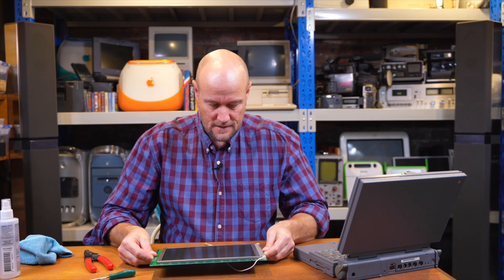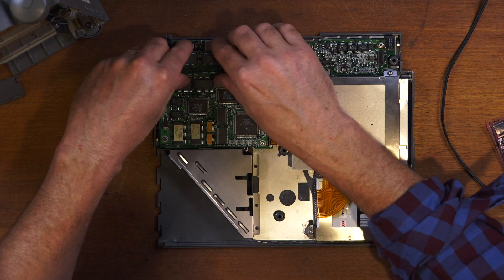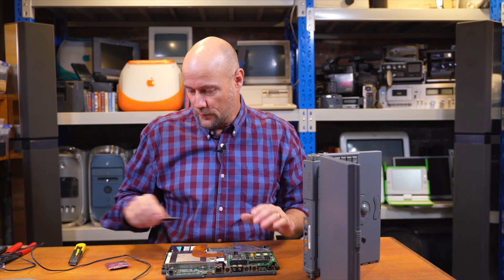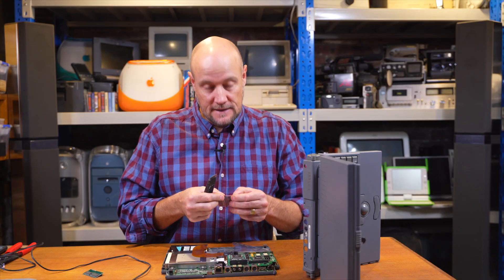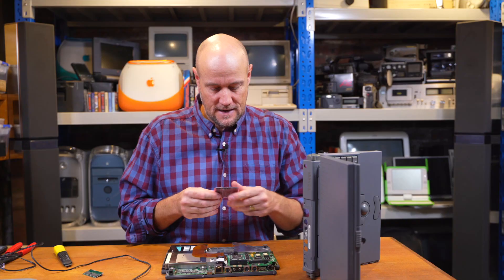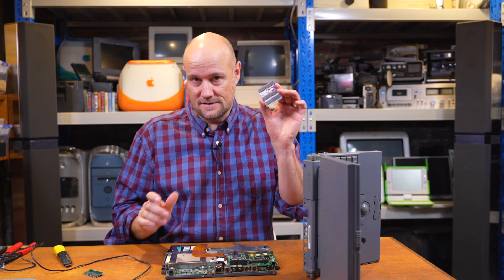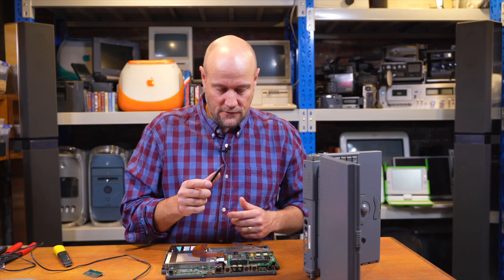Okay, that's them all tightened. Here's our screen. Let's get it back in the machine with the upgrades, fire it up, and see what happens. I've pulled the top of the laptop off to get access to the CPU and memory area. We're going to remove the old chip — this is actually a 2 megabyte chip, so there's 2 megabytes soldered onto the motherboard plus these 6 megabytes, which is going to give us an 8 megabyte machine. Silicon Insider is the guy who makes these — you can find him on Instagram. He makes RAM and VRAM and all sorts of cool things for old Macs that we can't find anymore. And it's this cool purple color.